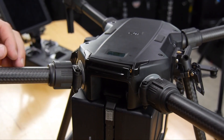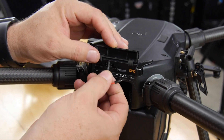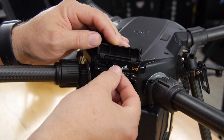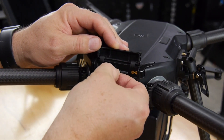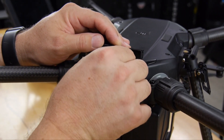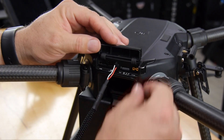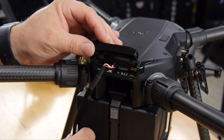Next step we're going to go into the programming of the auxiliary ports in the back. We've got the split cable here — you're going to want to put that into the first slot. You really can't mess that up because it's got a slot right on there. Push that all the way in, and then grab the 5-volt power from the last port where that little notch is, and simply insert that in there. Make sure those fit all the way in and then you're good to go. Next we're going to go on to programming the port and how to actuate the opening and closing.